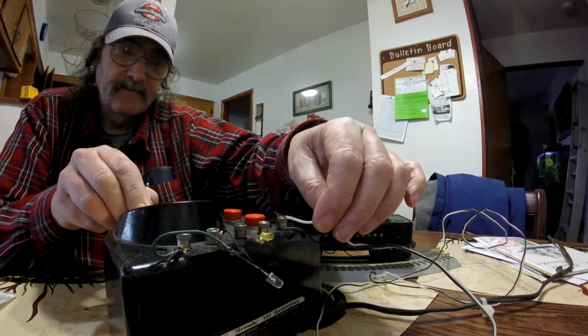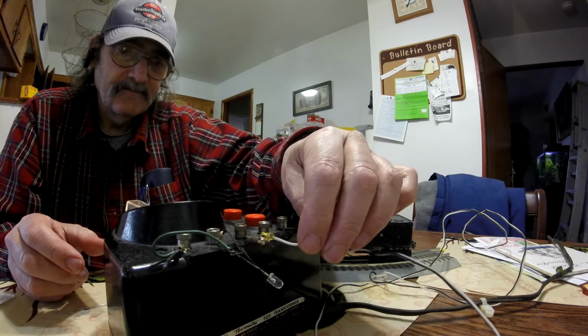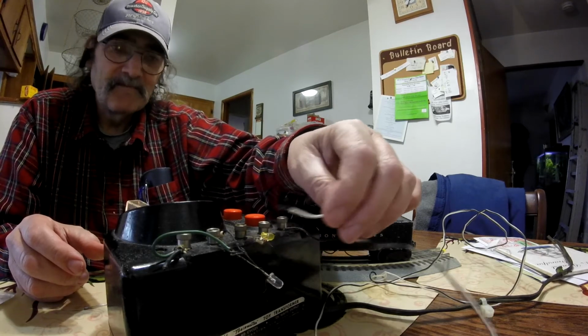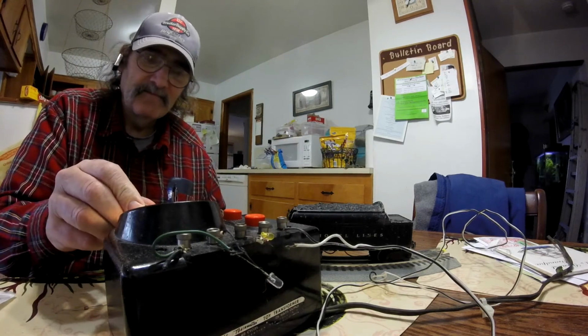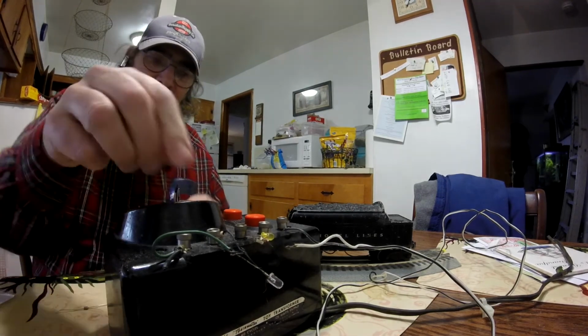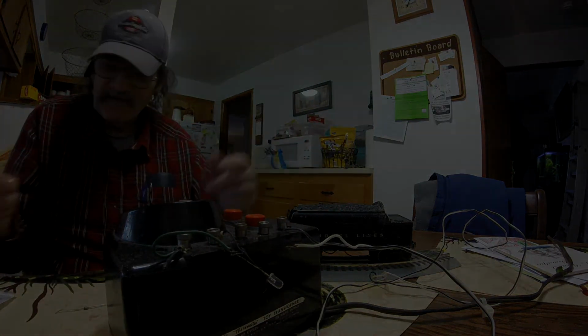Okay. Well, I could probably put a resistor in. It lit up, and I think I just burned it out. All right. I just toasted that LED. It lit and died. So it couldn't handle it. But I wonder if I put a resistor in there, but I probably wouldn't have enough current to drive the motor.